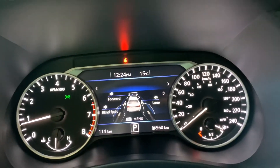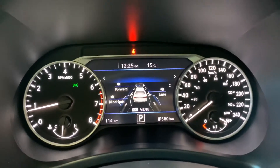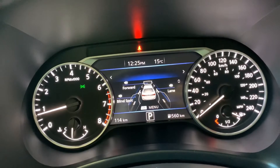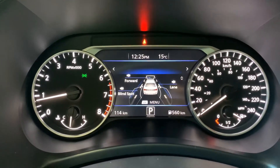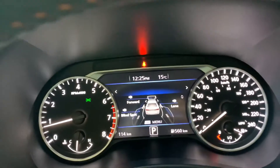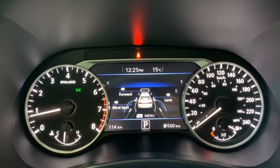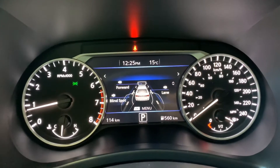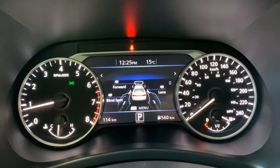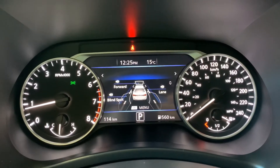In the front, you have automatic emergency braking with forward collision warning. Forward collision warning is something you will experience — I typically get it a couple times a week. If you're driving along and the car ahead of you is turning onto a side road at about 10 kilometers an hour while you're approaching at 50 to 80, the radar behind the Nissan emblem picks up that you're quickly closing the gap. Inside the vehicle it will beep at you. The car ahead finishes their turn, the beeping stops, and you continue on as if nothing happened.